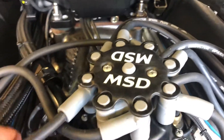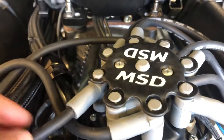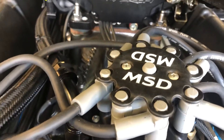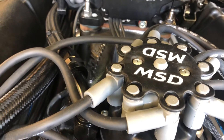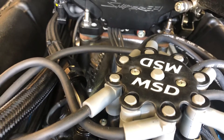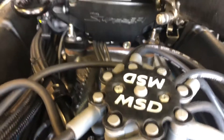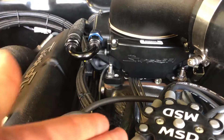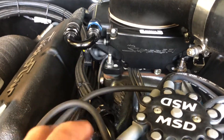Route your plug wires out of the way of that hole so you can see it. You're gonna need a timing light — make sure you put your timing light on the lead that is where you drilled your hole. Set static timing to a certain amount. You could do it two ways: look at it through the ranges, or like I did — I did static and adjusted my static setting, so 10 degrees, 20 degrees, 30 degrees, 40 degrees, and made sure it was roughly in range throughout that.